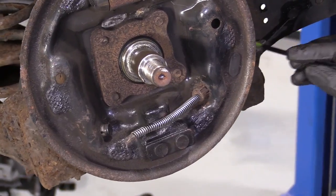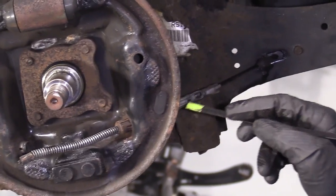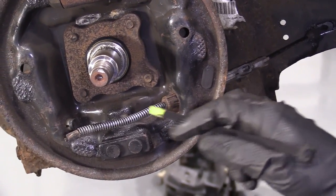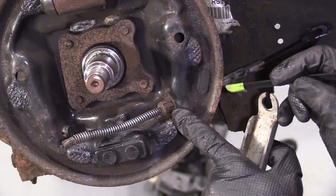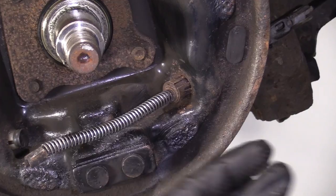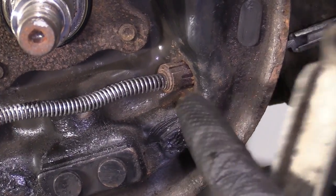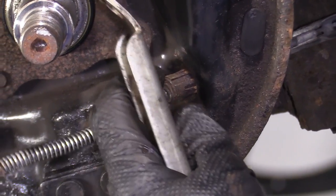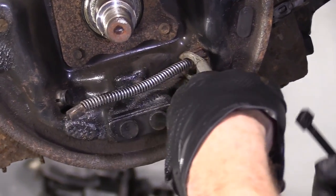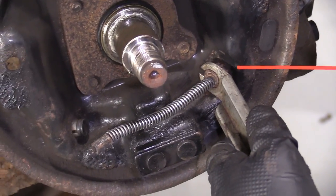I'm going to reuse all this. If I was replacing it, I would need to reuse this adjuster. So this right here is your e-brake cable — it comes through the backing plate, comes through this way, and then up to your vehicle. Our new subframe comes with this piece attached to it, but it's easier to just come through right here. The e-brake cable where it comes through the backing plate has these little ears — basically once it goes through, they peen out and make it so you can't pull the cable back through. I like to use a little tool meant for this — other people use pliers or screwdrivers, but I have the right tool so I'll use it. A little bit of penetrant goes a long way.